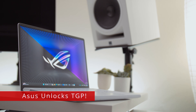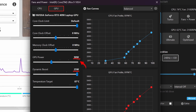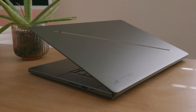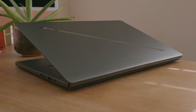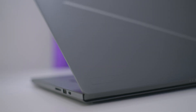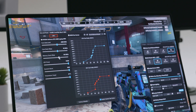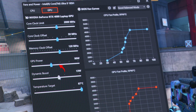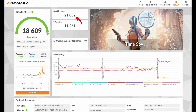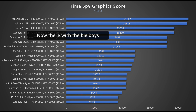A 2024 Asus laptop actually has a base TGP slider, which is basically identical to the Nvidia slider that was removed after that early 2023 driver. If you have a newer Asus laptop, you can download the 175-watt SCAR-18 VBIOS on your Zephyrus G16 - I did this in my review, running a 125-watt GPU at 175 watts. With the base TGP slider, I can adjust the base GPU wattage before dynamic boost, so I can run at stock 125 watts, or 150, or 155, or 120 plus 25 watts dynamic boost if the CPU isn't working hard.